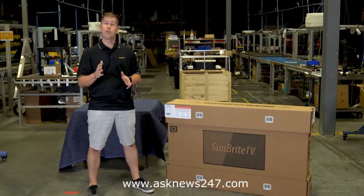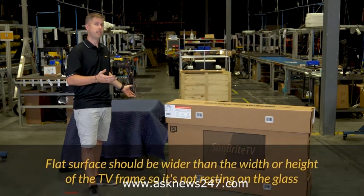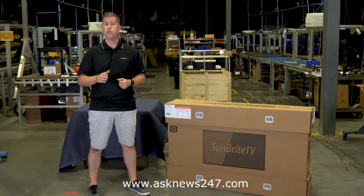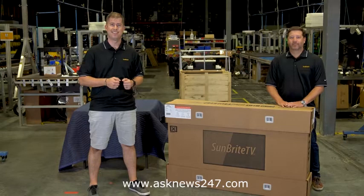This video is intended to walk you through the steps to unbox your new TV so you can avoid common mistakes like pinching the screen, which could cause it to crack. Before beginning, be sure to prepare a soft, clean surface like a table with a moving blanket or a towel on top of it so you can lay the TV face down to prepare it for installing a TV mount or a stand. Also, for TVs larger than 32 inches, we highly recommend an extra set of hands.